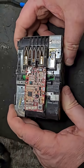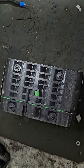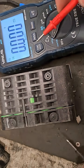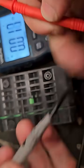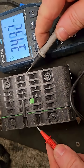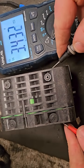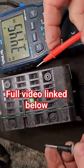I would say he's done a really good job on that — it looks rough but it's good enough. Doing the volt check to see if the cells are all good. I suspect they will be since when a fusible link goes it's probably just that. Starting the check: 3.45, 3.45, 3.45, 3.45, 3.45 — this is looking good — 3.45. They're all good.